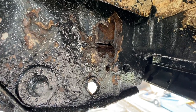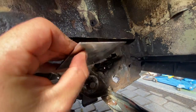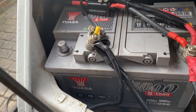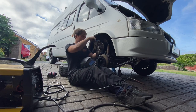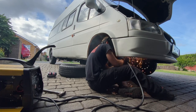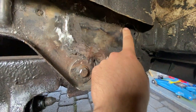I've got a bit of a hole in my spring hanger, so I'm going to grind this back and see if I can get a patch in there. As you can see it's exposed a massive hole. I've cleaned up all this area as best as I can - I've got a nice big plate here, I think it's two millimetre sheet metal. I'm going to weld this over the top. I've disconnected the battery so I won't pop any fuses firing a lot of current into the chassis. I can't get the camera in here so I'll show you before and after. One patch welded in - discovered some more rust and another hole here, so I'm going to weld a patch over this and there's another bit in this corner I need to sort out.